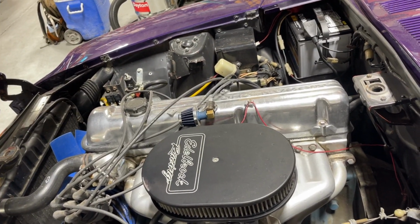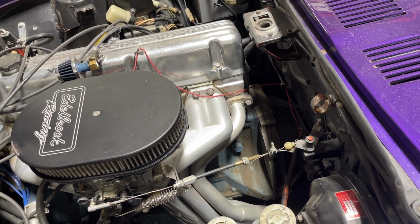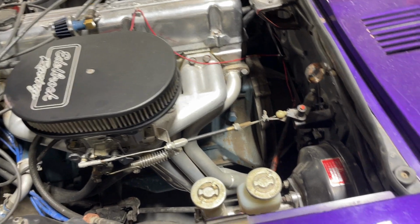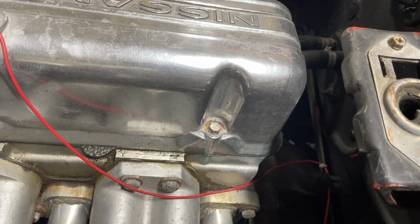The motor oil is really clean, but it's coming out really dirty on the bottom. So I don't know if it's trans fluid, but it's not red either. So I truthfully have no idea. Might be a rear main seal. Hold up a moment. Do you see that? It looks like the head is also leaking. Or not the head, the valve cover.